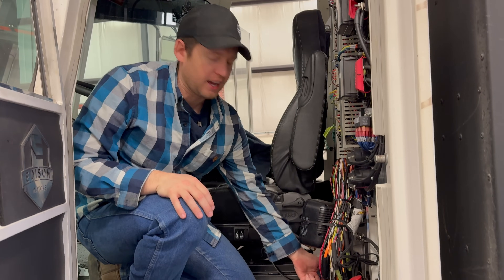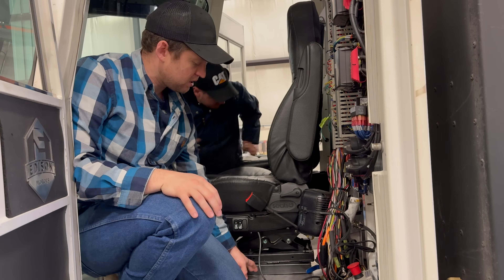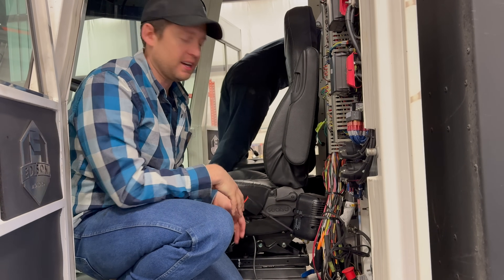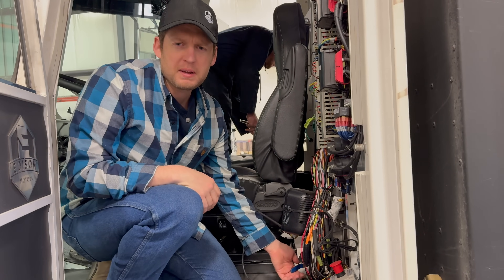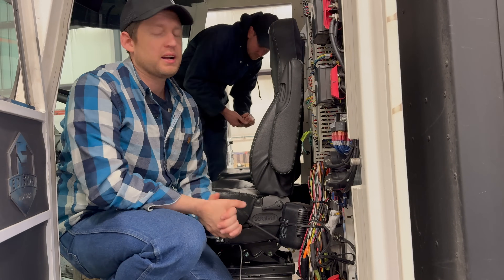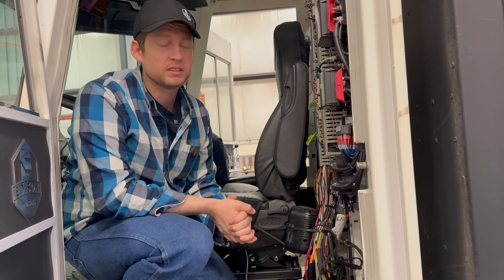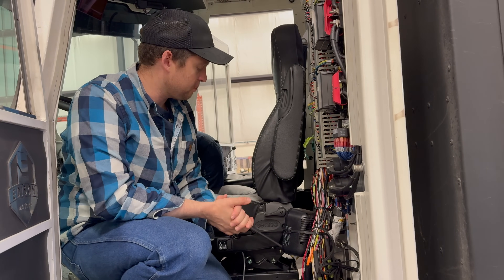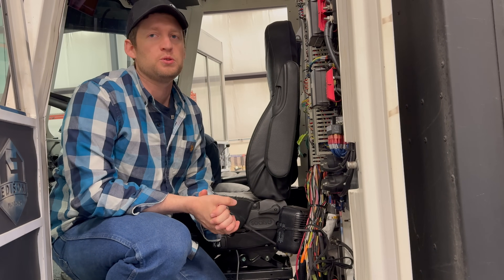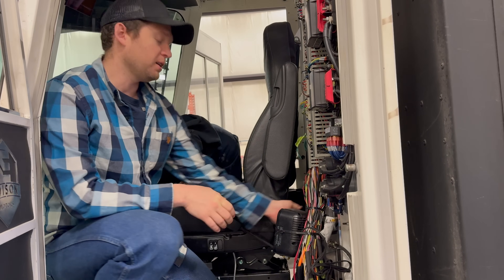Right now this is just the air valve for the air horn. Before, I disconnected the air ride seat because our BMS is located under this box, so we're just going to take the floor panel out and then we have easy access to everything under there for maintenance. I better make sure there's still air in the system — with this steel braided line, this truck has been parked for six weeks as we waited for the new BMS to get here. Very long six weeks. But I still have air in my air system. Compare that to a new truck — show me a brand new truck rolling off the line that still has air after six weeks of parking. That's why you build it right.